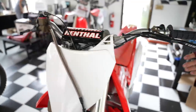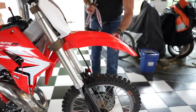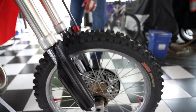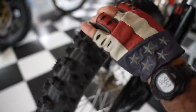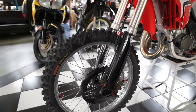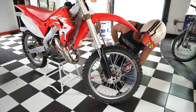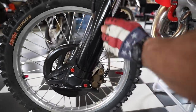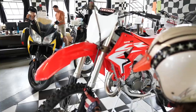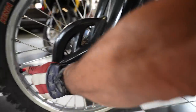I took it right down to the frame. The entire frame was vapor blasted. Starting at the front wheel: it has a new Kenda Millville front tire. There's no ride time on this bike since the rebuild. The front wheel was completely dismantled — brand new spoke set, brand new tubes. The original rim is in mint shape and was polished. The original hub was rebuilt and Cerakoted a nice bronze color. New bearings in the front, new front rotor, caliper completely rebuilt with new Cerakote finish and new brake pads. Fork protectors are brand new, new billet brake cable holder, new hardware anodized red, new anodized red rim lock, and new anodized red valve stem cover.